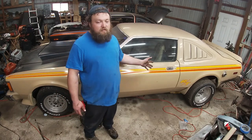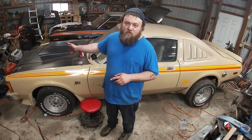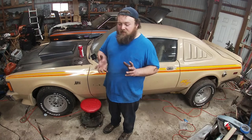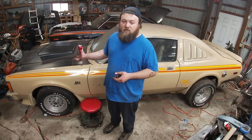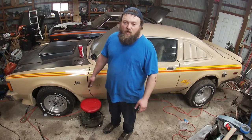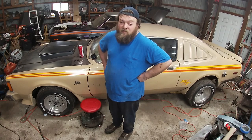Now we have our car — that's pretty much a drivable candidate. For the cooling system, I bought a part-store radiator from Advance Auto. A lot of you don't know, but Advance Auto has great aftermarket radiators compared to Autozone or O'Reilly's. Every time I order them they're cheaper and they fit better. This one — the bottom mounts bolted right up to everything with the 22-inch radiator support, which is what the slant 6 cars had. The 360 cars had a 26-inch. The only thing that was different was the top mounts were too high, so I had to drill new holes. The radiator — just a 2-core plastic and aluminum — was about $110.